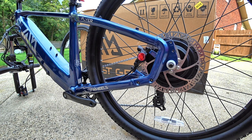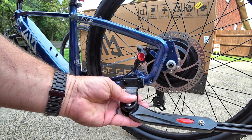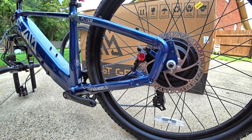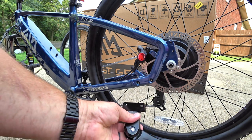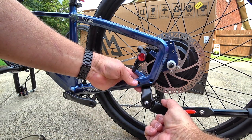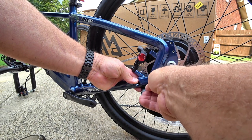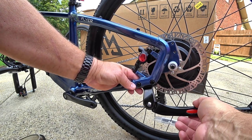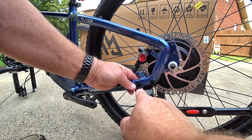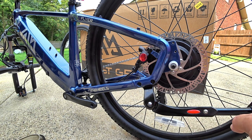The first thing you should do to help keep the bike balanced is put the kickstand on in preparation for when you put the front wheel on — at that point you can put the kickstand down and the bike will stay balanced. The kickstand goes on the backside; there's a machined area for it to fit and the screws go through the front side to hold it in place. Once the screws are started, make sure the kickstand is seated in its position, then tighten the screws down. If needed, the kickstand height can be adjusted using the adjustment screw.